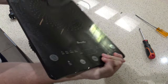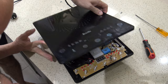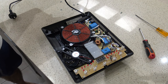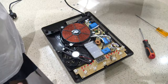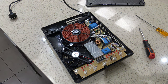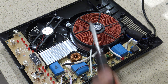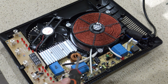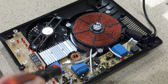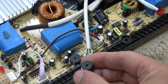I would imagine that's all attached to the bottom. Okay, that's what's in here. I can see this big capacitor, which makes sense because it's a coil — you don't want a big inductive load on the power supply because then the power factor would be off, so I guess that's why that's there. I didn't think there'd be too much in this, just a bit of control circuitry and a fan. Anyway, that thing there is a beeper — that's what I've got to rip out, very much like the other one.